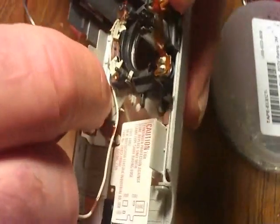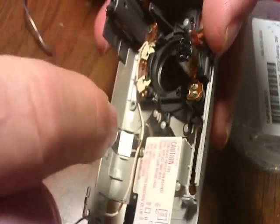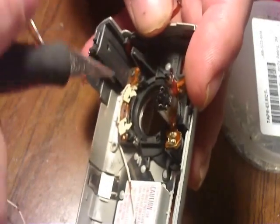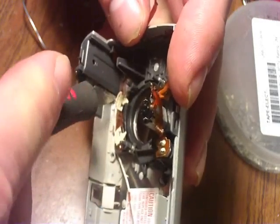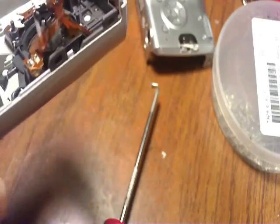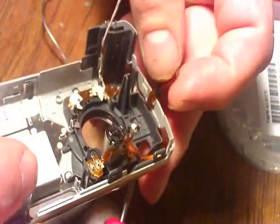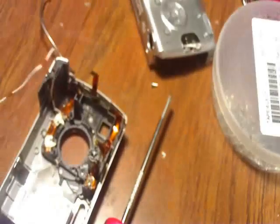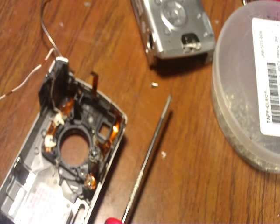This is a really not a very good solder job for the S40 — it probably did work though, there's a big clump there. This wire was hitting — we need to make sure the wire is away from those two holes. I'm definitely not going to be using this wire again. I've stated before: when you desolder this, you need to tape that or it can short out and ruin a good camera.